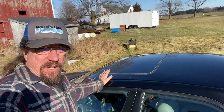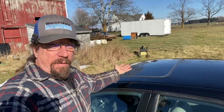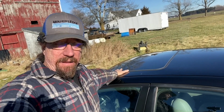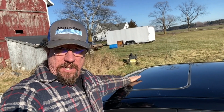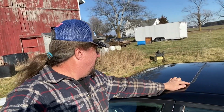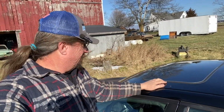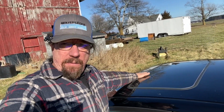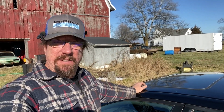Back when I first got this car, I was closing the door one day, and I noticed the sunroof was popping out, and I was noticing that there was some water damage coming inside the car. Well, it turns out that the sunroof itself was a similar issue to exactly what he had. It was about from here over to somewhere in here, this whole corner wasn't glued down like it should be, so I was able to pick it up and run some RTV in there and put it back down. Well, temporarily fix it, which was, I've had this car for 7 years.